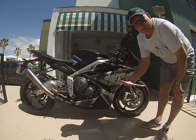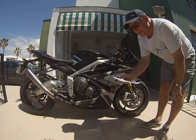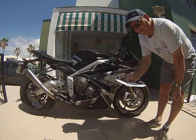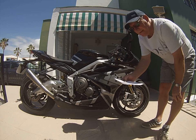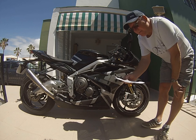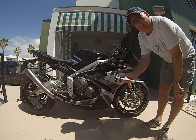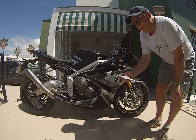It's boiling hot today — 30-something degrees and I'm dripping sweat. On compression, standard is 16 clicks anti-clockwise and Pete is down at 15. On the rebound there's a massive change: Pete is six clicks out but the factory setting is 14. That's a really interesting one — I'm hoping we'll be allowed out from the 11th, which is next Monday.